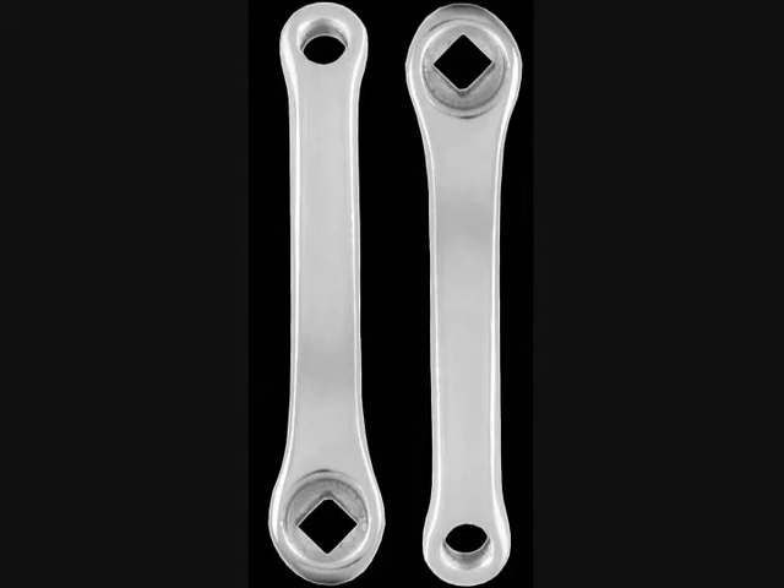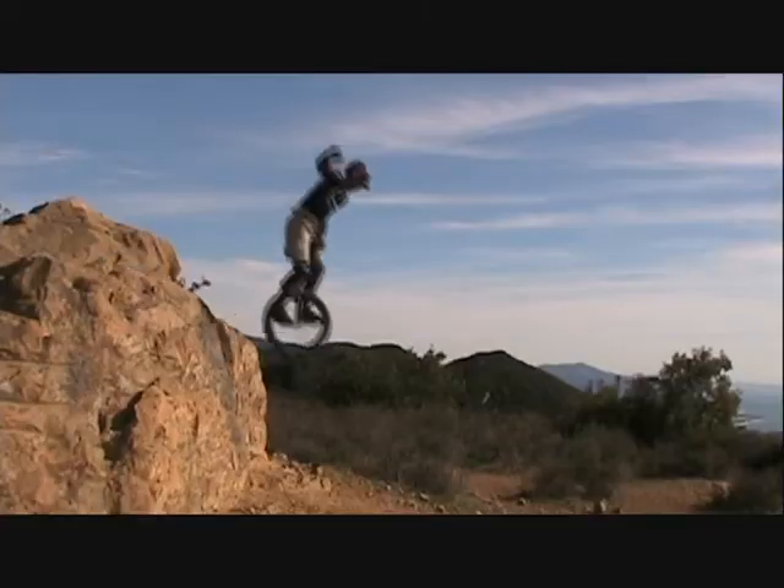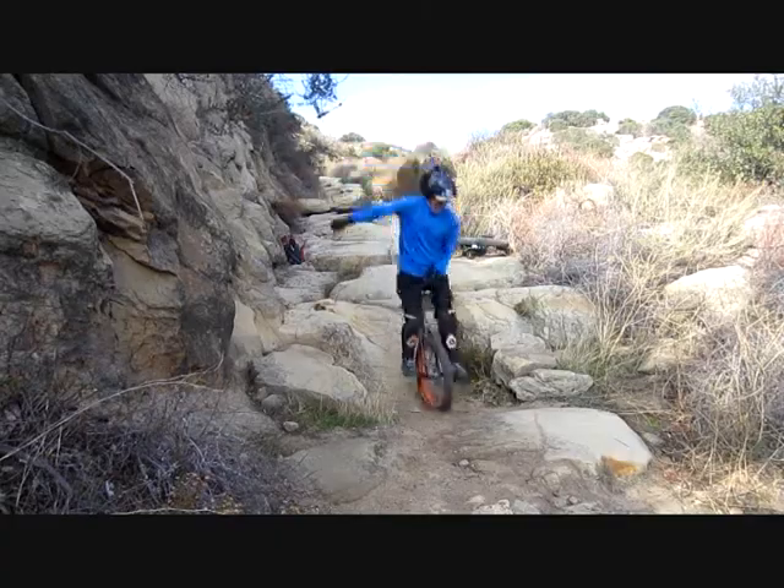There's been quite a lot of improvement in unicycle technology since the 60s. The two main types of cranks available today are the square taper or cotterless crank — these are perfectly fine for riding around town and not doing anything too extreme, but don't use them for anything extreme like doing drops because they will round off. The second type of crank and the strongest system we have today is called ISIS Drive. As you can see, it's a splined type of axle made of hardened chromoly, and this is super strong. I've done drops five, six feet over technical terrain and they're still strong and like new. This utilizes the center bolt right here — it's a strong system.